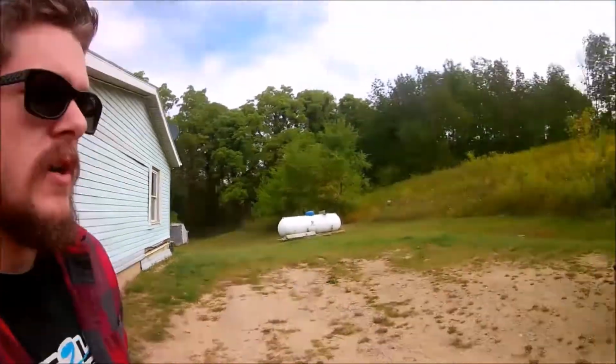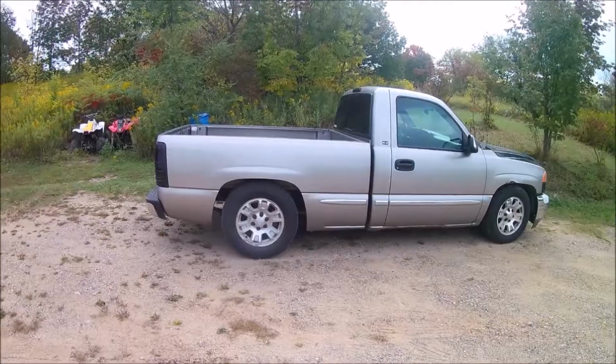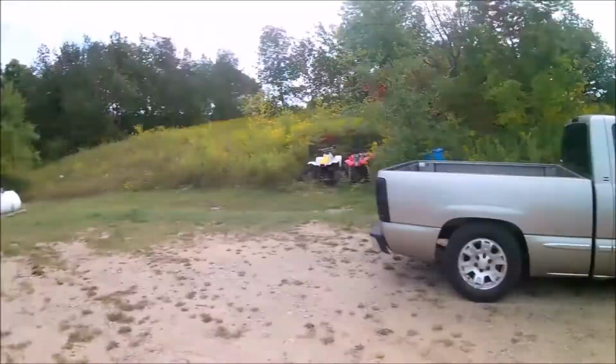What is it like to drive a truck with a 4.6 drop? Honestly, it's not that much different than driving a stock suspension truck. If you do the flip kit in the back, obviously you'll keep the factory springs, so the spring rate will stay the same, so that'll just depend on what shocks you decide to run.